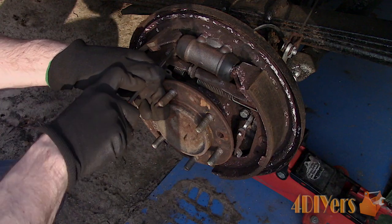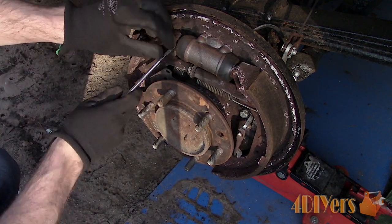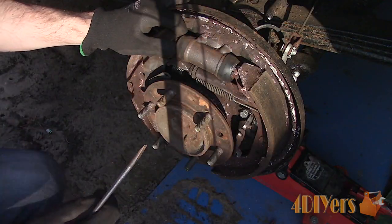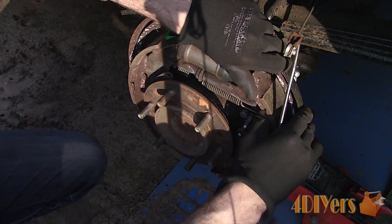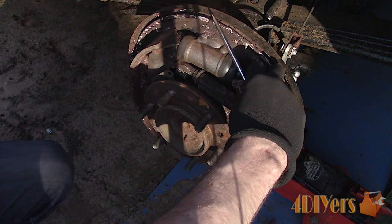However, this can also be done when the shoes are off the vehicle. There are a couple different ways to disassemble the brake assembly and I will be showing those — it's whatever you're more comfortable with. Pull the pads from the wheel cylinder and the pivot location to help relieve some tension on the springs, making the removal a bit easier.